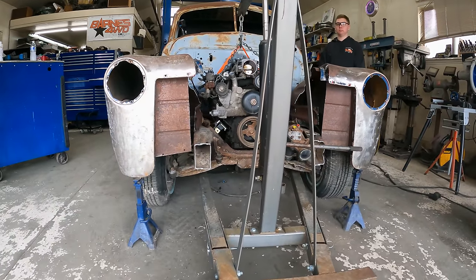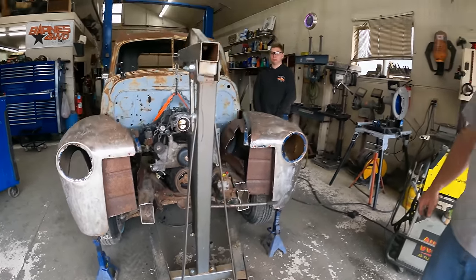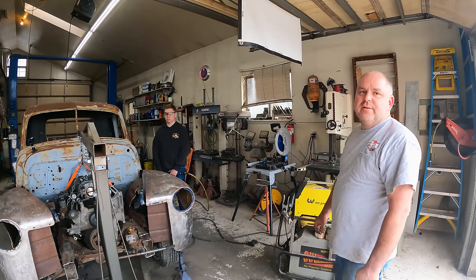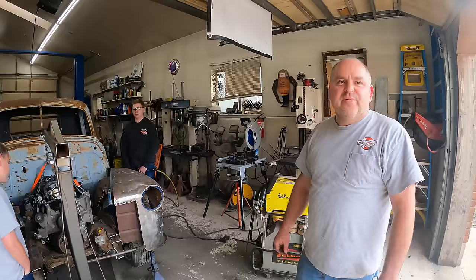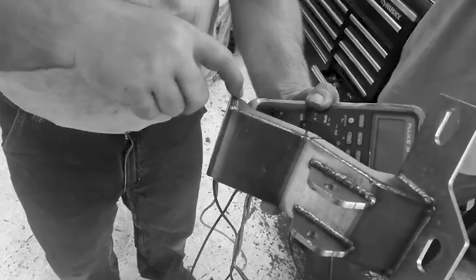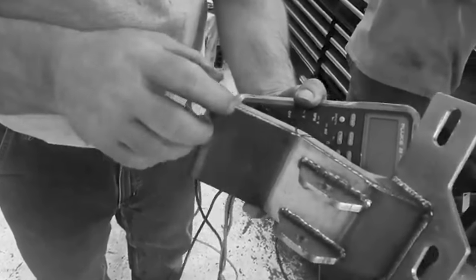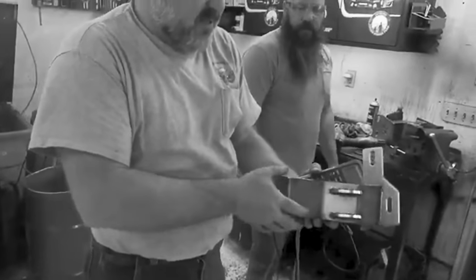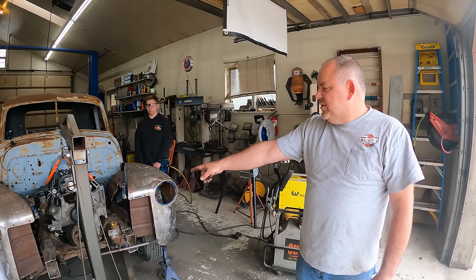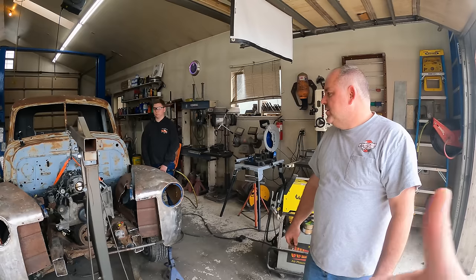Those look like Dusty's mounts — yep, they are the same. They're old-school big-block Chevy mounts. We're going to cut a little pie cut out of that tab on both sides, then straighten out this band so it comes up straight and goes straight up to the bottom of the frame rail. Then we'll cut the top bracket piece off, get it all fitted, and see if we can make it work. It's the same insulator but we're making the part that bolts to the frame. Okay Kenner, cut away.